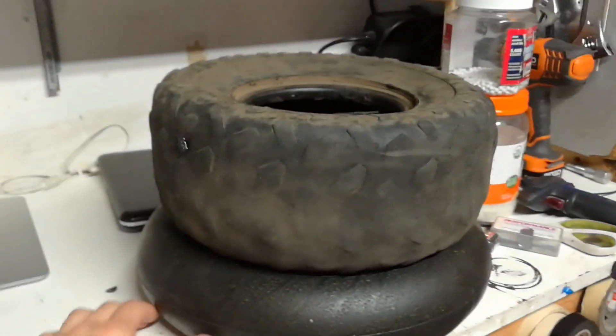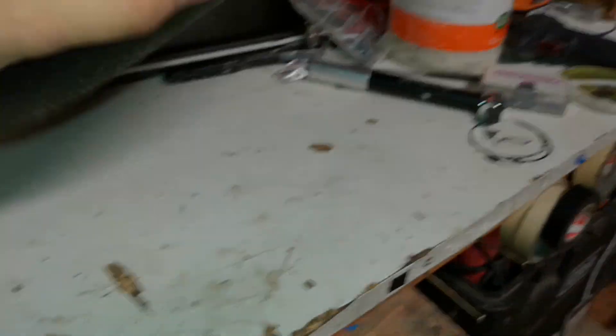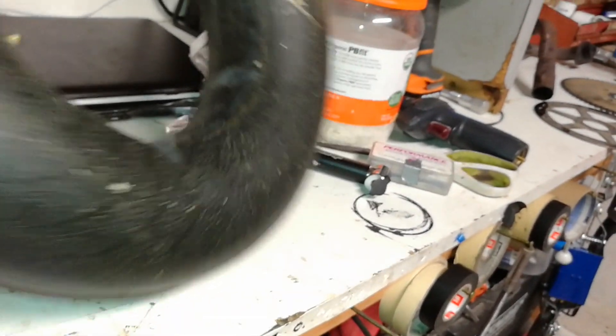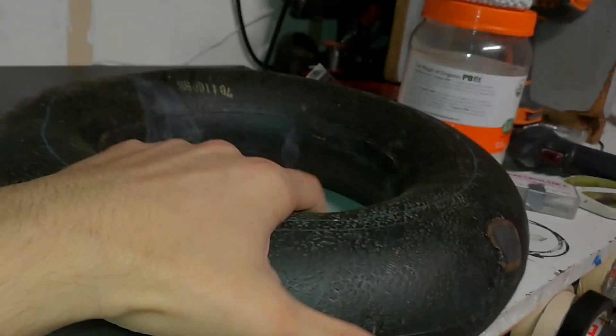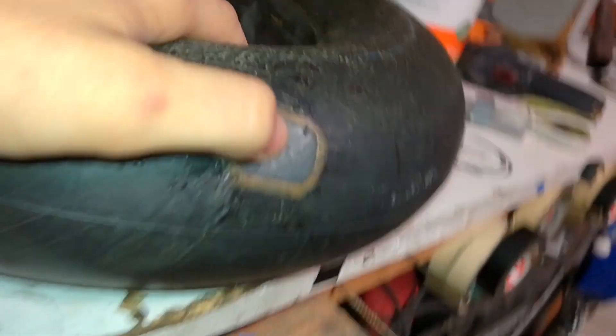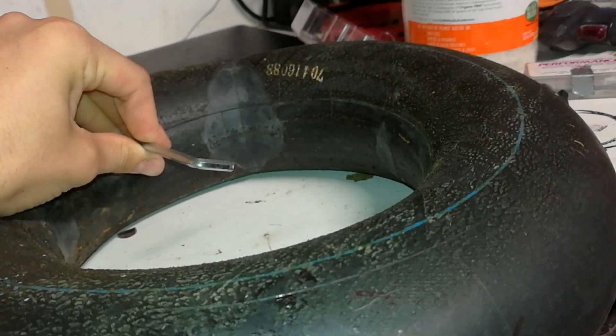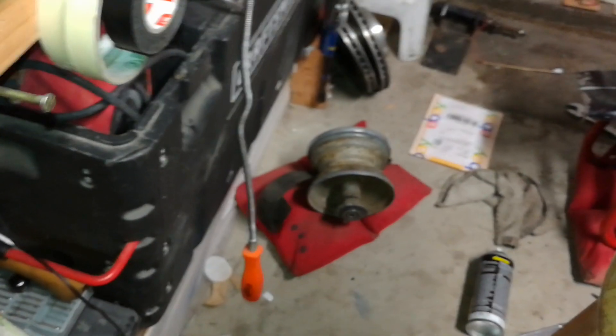Okay, so I just got back — it's been about a day since I checked on this part of the tire. It's pretty solid. I just don't want things being able to poke that hole easily. As for the tube, we plugged that, set a bunch of weight on it, let it sit, and it hasn't really deflated at all. The only change is just pressure due to changes in air temperature — other than that this thing is ready to go. I'm gonna drain it a little bit just so I can easily fit it in the tube, then throw the tube on the rim, clean the rim a little, then put the rim on the bike and we're gonna go ride it.